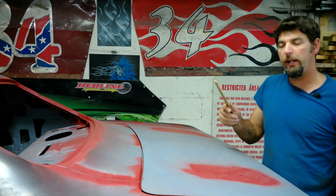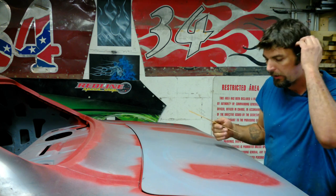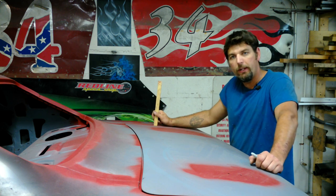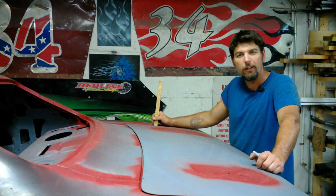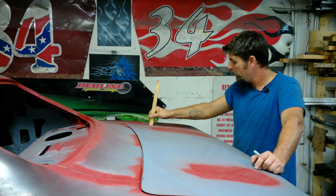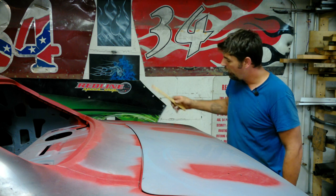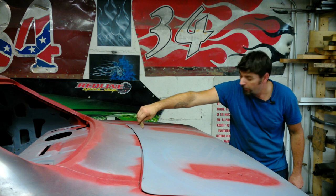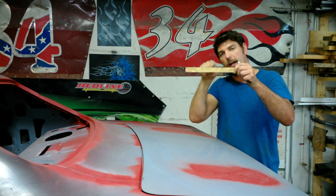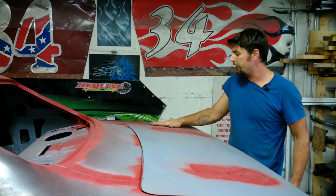We're going to use this paint stick as our reference — I believe it's about 3/16 inch, which is about what I like to set my gaps. It gives a good balance between too big and too tight. We're going to slide it in — I want it to slide without hanging up or gripping. That should give us plenty of room but I also don't want too much side-to-side movement. You can see we're starting up here in the corner moving down — it's tight the whole way and this corner is good. I'm also going to turn it sideways and go down the whole trunk gap, making sure everything's straight and I don't see daylight under there, checking that they're lined up in profile side to side.